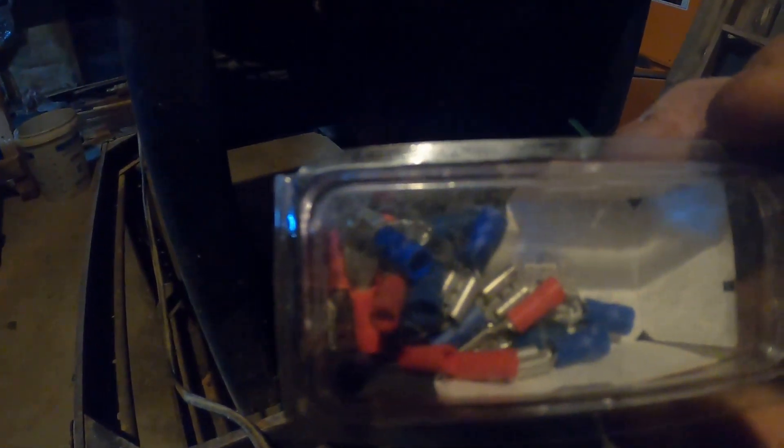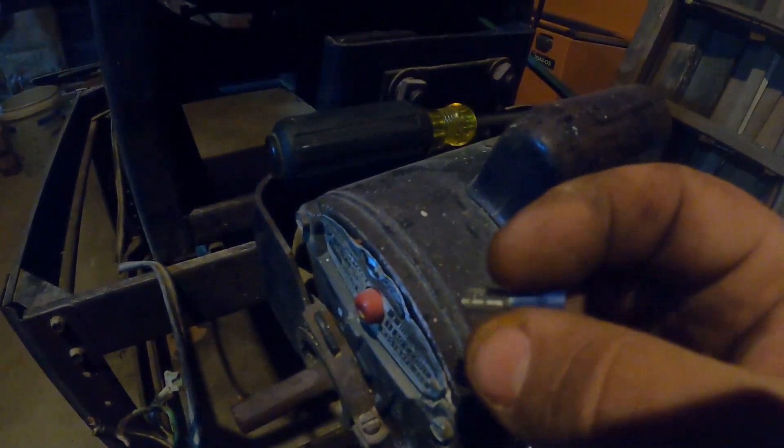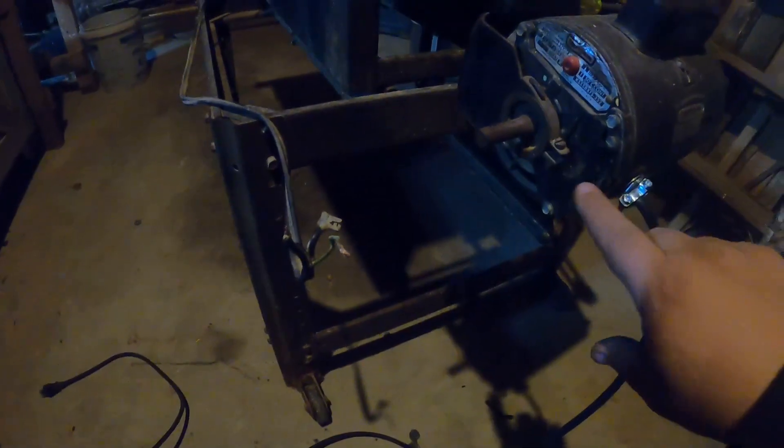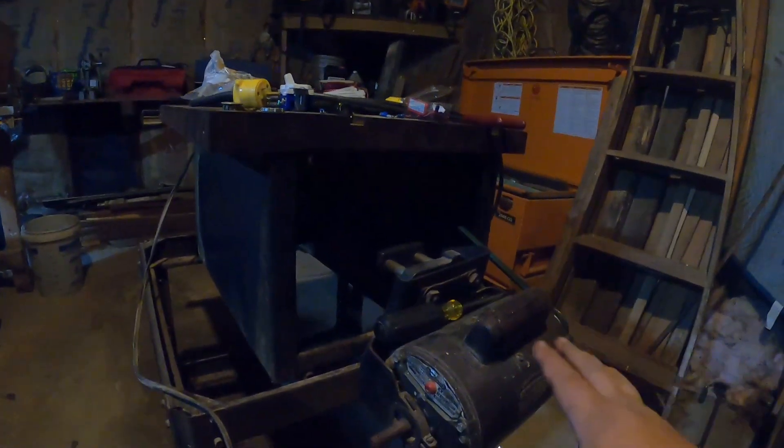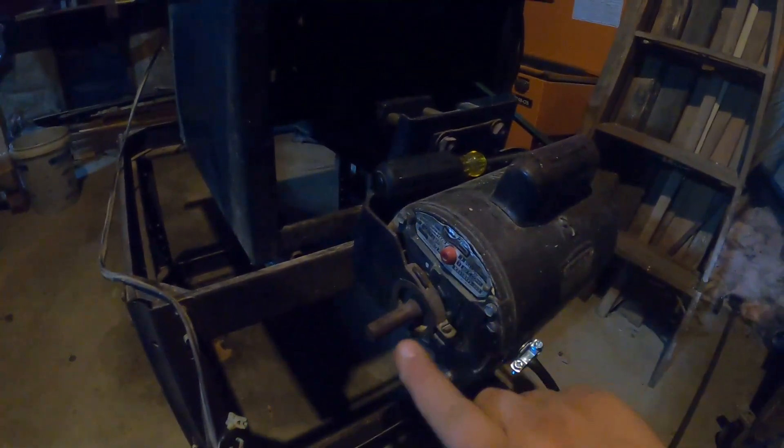They kind of look like those — you will have to bend these over a little bit once you get them crimped, to slide them on, because they do stand off unless you get ones like the originals that crimp sideways. You gotta make sure you get hooked up right in here, because if you don't it will reverse the motor, and next thing you know the motor is running backwards. We're going to run this up in here, underneath there, kind of out of sight, out of mind, and mount it with zip ties wherever I can.